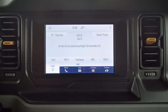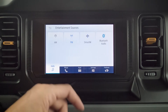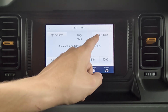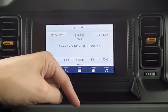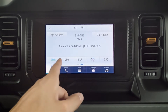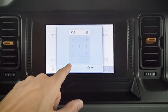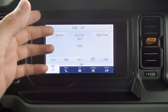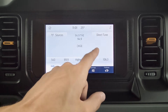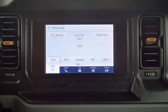Starting off with our audio tab, we've got a few different options. Looking at sources, we can change between AM, FM, Sirius XM, and Bluetooth audio. If we had a USB stick with MP3s, that would also work through the screen as well. We can direct tune, and we've got a tuning knob a little bit further down as well, so we've got a lot of flexibility. We can direct tune — let's say 94.9. In order to save a preset, all we're going to do is change to whatever station we want to, and then press and hold, and the preset's now saved. It's that simple.